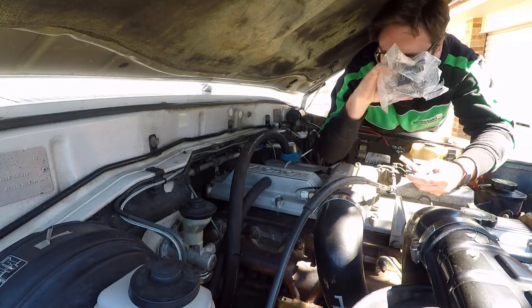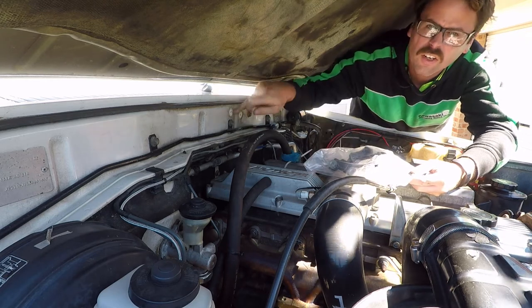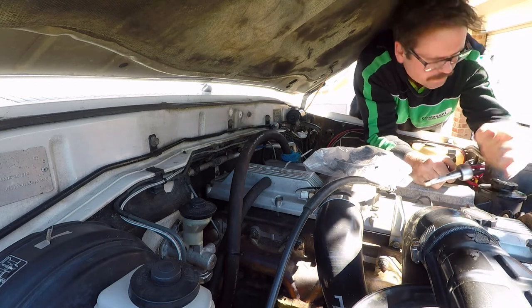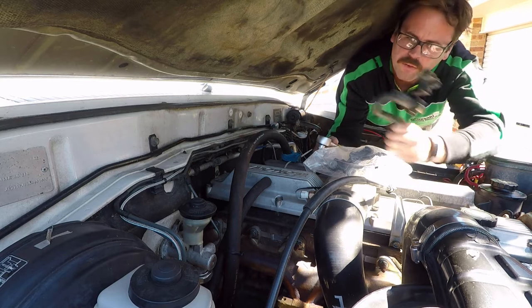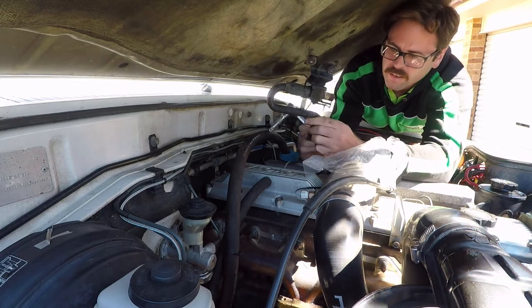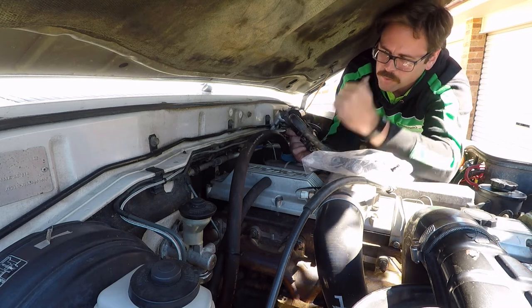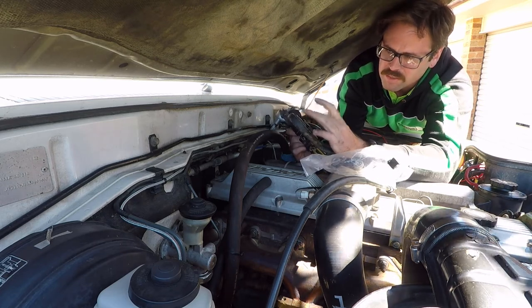The first step — I'm going to mount the heater hose. I've got to cut a few small hoses because I've got a little looped copper pipe that I was hoping to do away with. But I couldn't get a hose to go from there into the heater core, so I'm going to have to retain it — which isn't a big problem. I've just got to have a few more hoses and clamps and cut a couple of hoses up to join those bits.